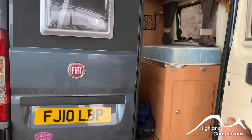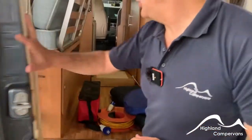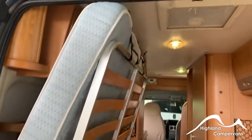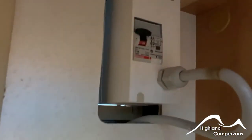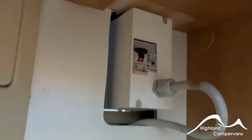There are a couple of features inside the back of the van — we've folded up the bed for convenience. Staying with the theme of the mains hook-up, when we open up this locker on the left-hand side, up inside the top of the unit you have your mains circuit board switch. It's just a single switch: pushed upwards it allows the main supply to come in; pulled down it will shut the main supply off. In the bottom of that locker, you don't have a spare wheel on this van, so you have a reflation kit consisting of a pump and some gel that can be squirted into the tyres to refill.